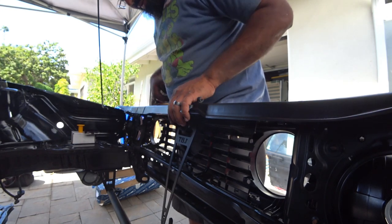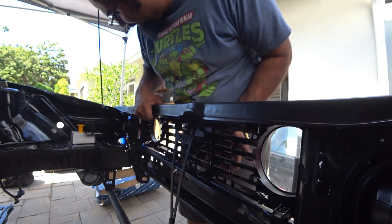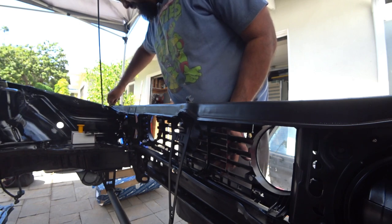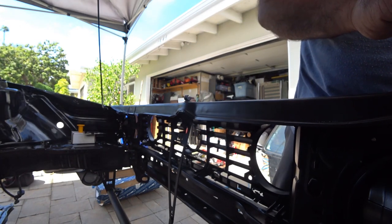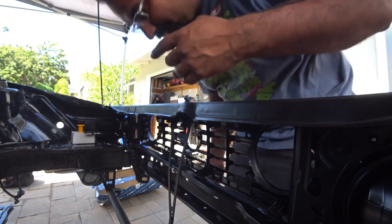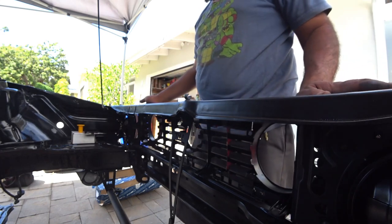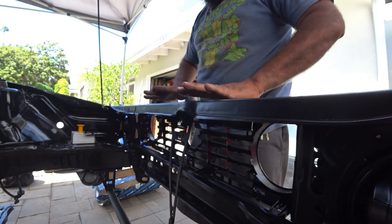In my previous video, we saw us installing this bracket, so you have to kind of put it in, slide it in first, and then mount this guy here, and then get your top screws in. They don't want to be snug, they just got to be in, and then your little tiny screw for the bottom bracket here. Everything I do right now we hand-tighten, because it gives us the alignment room we need to actually manipulate and get everything set correctly as we work on stuff.